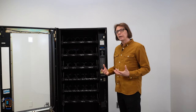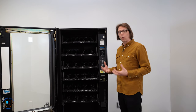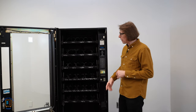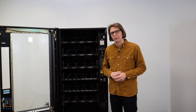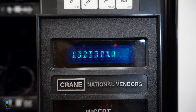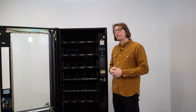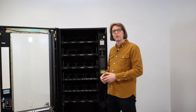To start coupling a selection on the D or candy tray, we're going to enter the controller motor number, which is always the even numbered motor. We're going to be using D0 and D1 — marrying, coupling or unioning those two motors together. So I press zero on the lower keypad, and the screen changes with a plus sign where D0 was. I have just coupled these two selections together, so when the customer presses D0 both motors will turn at the same time.